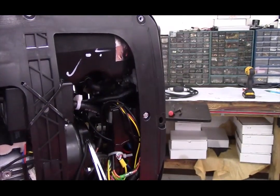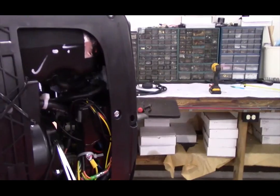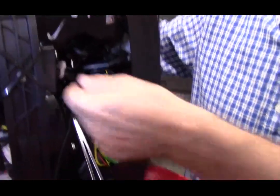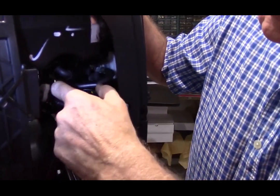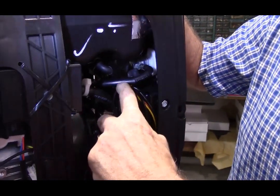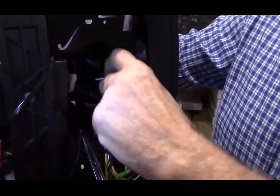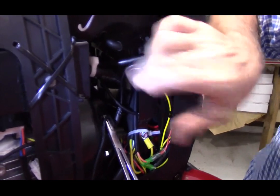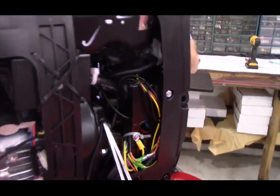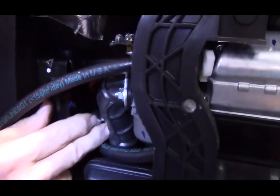There you go. You just squeeze the Corbin clamp and work it back on. Now if you'll notice, there's a metal bracket right here. Slide the first rubber protector to where it goes, right where the metal bracket is. And that way if there is any touching, it doesn't chafe the fuel line up. The other section, slide it as close to the T-fitting as you can get it.